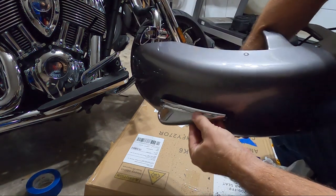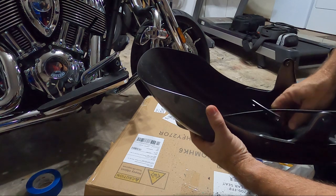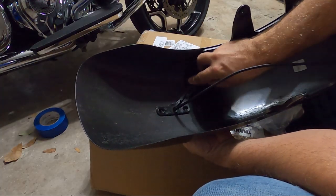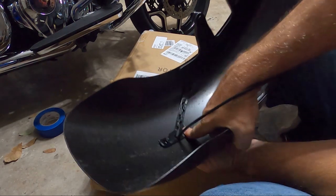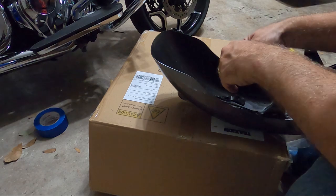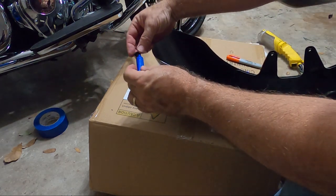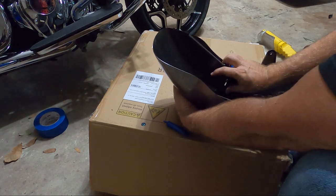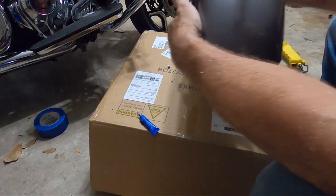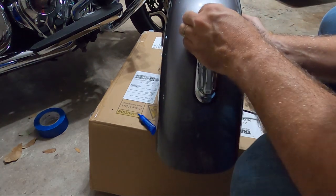We've fed the wire, got the war bonnet on here, got that grommet in between — just kind of holding it in position. Line up the screw holes, and this is the wiring loom that we were talking about — a pretty interesting shape. These two mounting holes go here and then it runs off to the side. This screw that goes underneath takes a four millimeter. Because this is going underneath the fender and I'm probably not going to be able to get back under here to double-check the threads, I'm just going to put a little bit of Loctite on here. I'm going to finger-tighten these, then take it off and check it real quick to make sure it looks centered and the grommet is sitting properly.